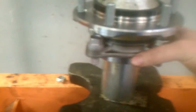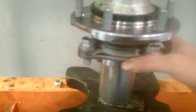If this hub were placed directly on the press, you wouldn't be able to rotate it. That would be because all of the force is being applied to the bearings themselves, which can cause chipping. So the only way to properly press this on without causing any damage to the bearings or any stress on them is this method right here.